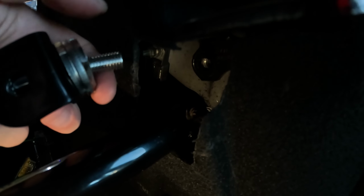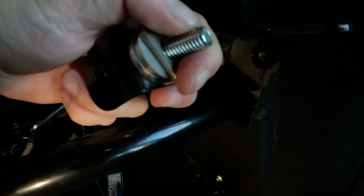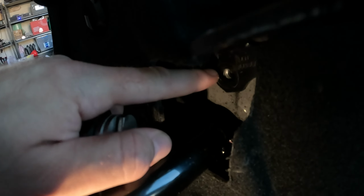And that'll give me the right space, because when I put it in and measured it all up, it was slightly off and wouldn't align with the holes. And the bracket with the adjustable hole does not suit the 10 mil bolt used at the top, because the one down the bottom is not a 10 mil, I think it's 8 mil. So the brackets are specific to top and bottom. You won't be able to go, oh well, why don't I just put it up here, because it won't fit.